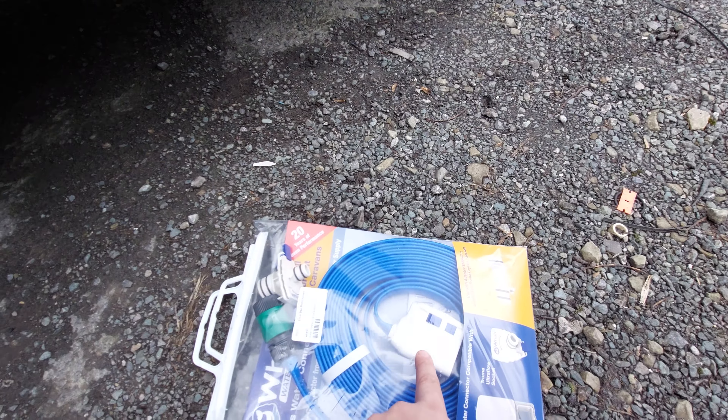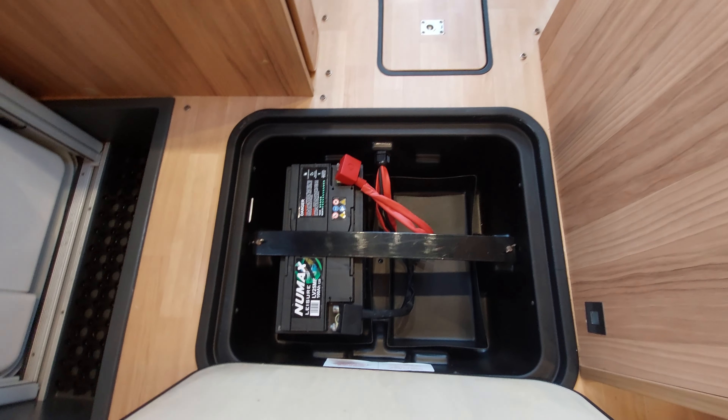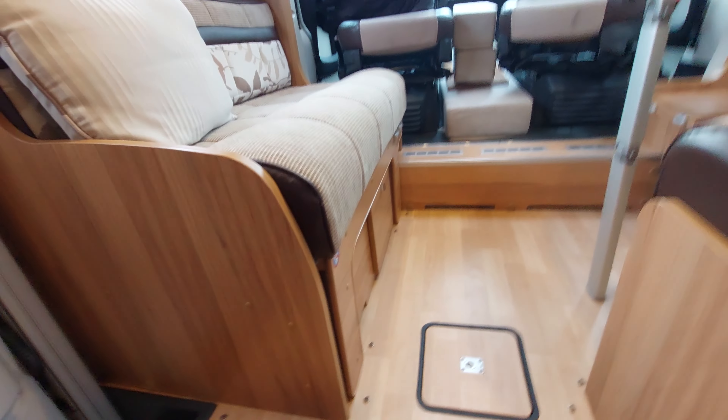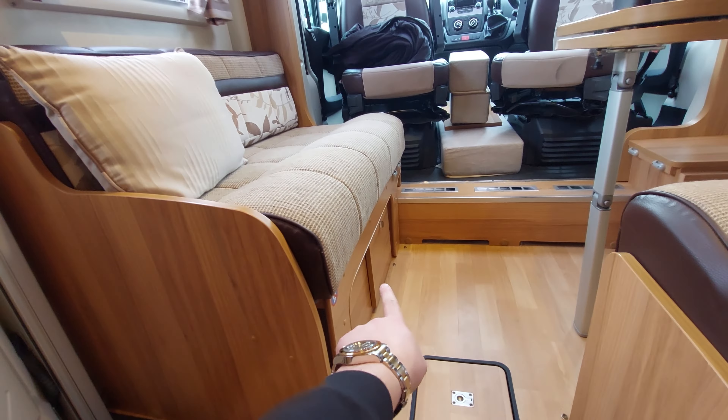Back to the dinette format now. Important things to note: here we have a main circuit breaker — if you've got a mains issue, say a faulty appliance you've connected, these will flip down. There's also a bank of 12-volt fuses labeled across the bottom; for example the lighting circuit will have its own fuse.